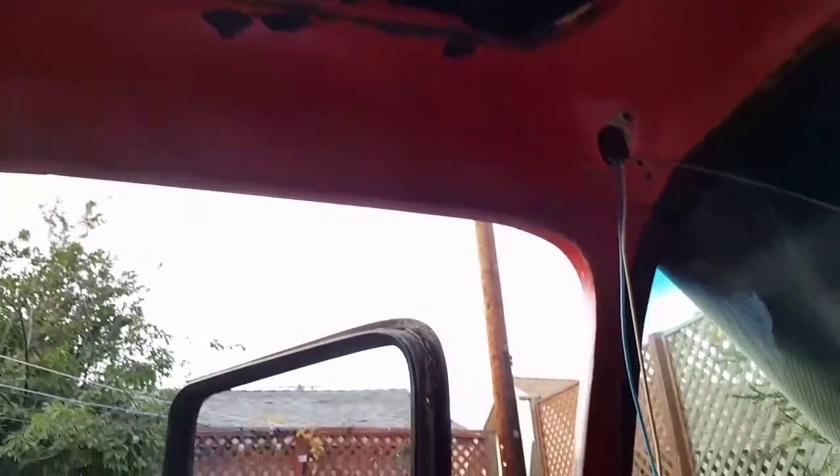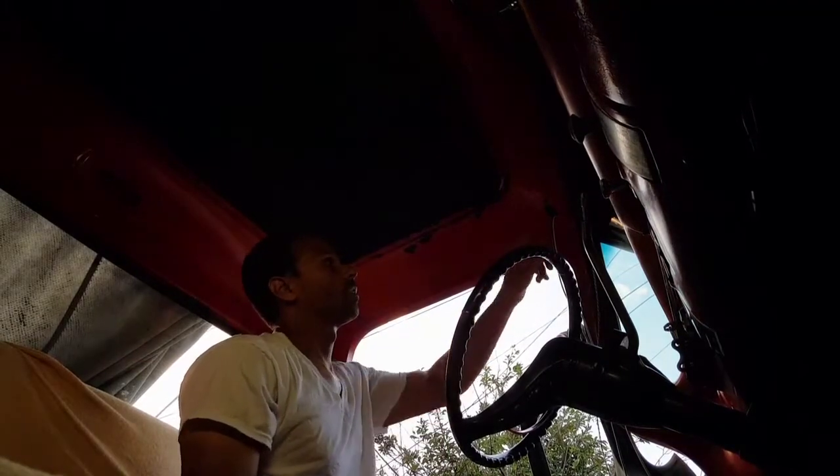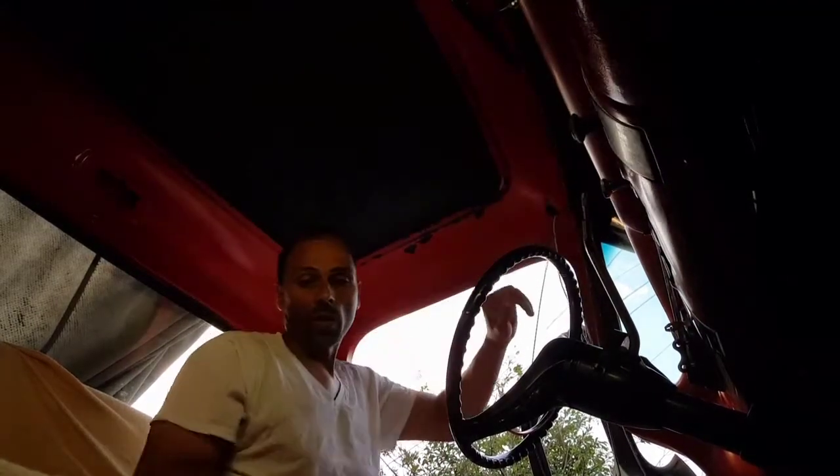Now I have to run new wires. I was able to get this wire run up through the A-pillar — the blue and the white wire are the ones that are going to connect to the dome light. You can see that piece of metal, which is basically a fish line. It takes quite a few tries but you fish that line through the channel. Let me see if I can fish this wire through here so I can get it on the other side and get started.